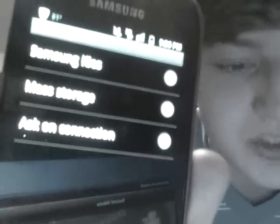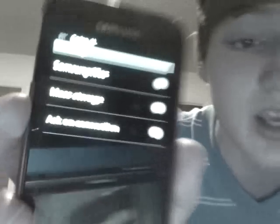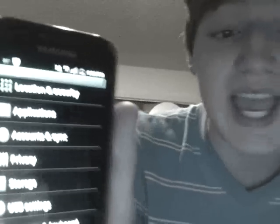You open USB Settings and it gives you three options: Samsung Kies, Mass Storage, and Ask on Connection. To fix it, change it to either Samsung Kies or Ask on Connection — just change it from wherever it's currently set. Then use your phone for a little while and the glitch will eventually go away. I had to do it multiple times for it to work.